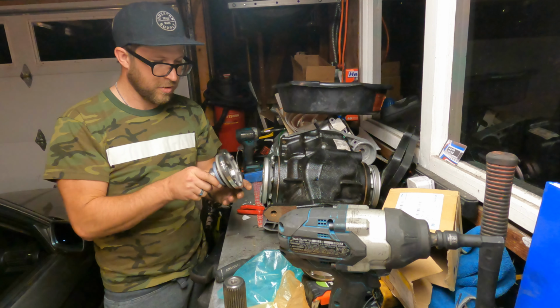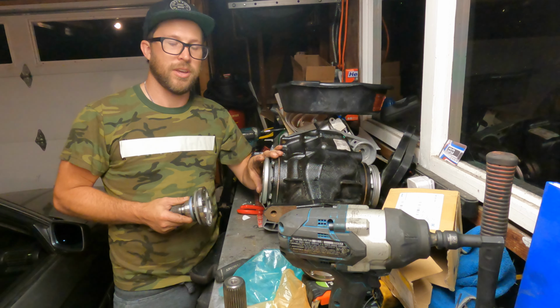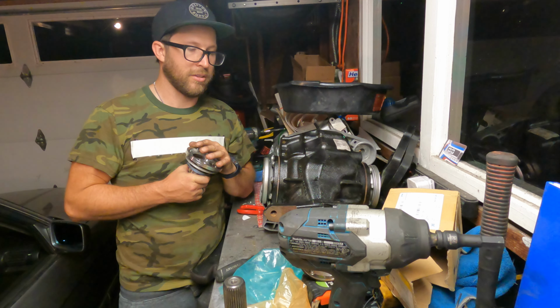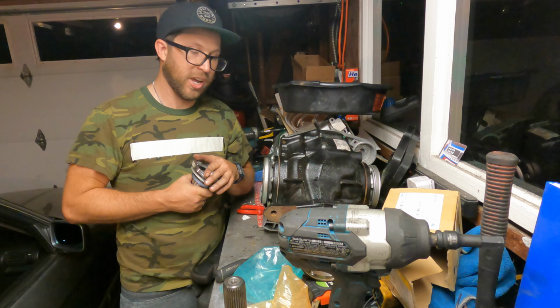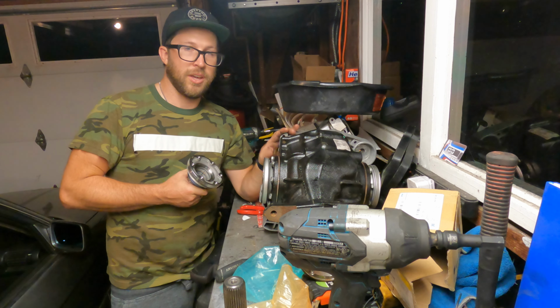Basically what it is though is that the bolt pattern on these is set up for an M6. The axles are completely different. So in order to get around that, you just go ahead and run these E46 M3 output shafts. That makes it so we can just run the stock 645 axles with the M6 rear diff.